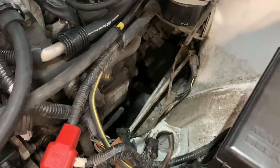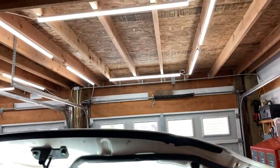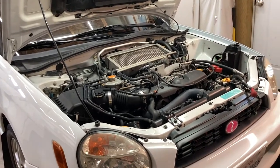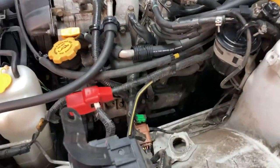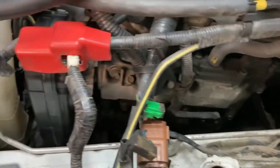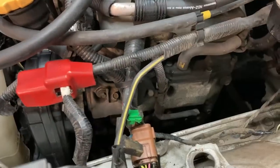Now that that's out of the way and giving me a little bit more room, I'm going to unbolt this fuse box and move it out of the way as well. That's a lot better. As a side note, I have these LED bulbs that I got from Amazon — I bought another set to install before I started this job to get a little more light on the engine bay, and just zip-tied one to the hood since I don't have one of those LED work lights. Now I have the fuse box moved to the side, giving me more room to get tools in there. I can see the valve cover right there, so now I'm going to see what I need to do to move some of these wires and get the oil fill tube out of the way.